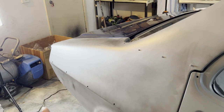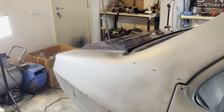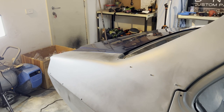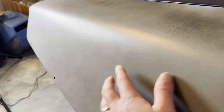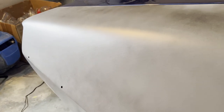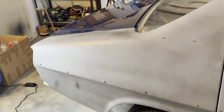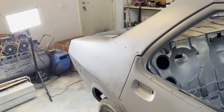This is one of the reasons why I try and emphasize on my videos that when you're doing repairs in your filler, you always finish in like 180 or 240. What that does is prevent all these scratches from happening when you prime it. Because if you were to sand that down and paint it, your metallic — when the paint's releasing all the solvents and drying, when the clear coat dries and everything sucks in — all these scratches here would show in your color. That's what's going to happen if you were to just sand and paint that. So when someone wants a nice job, you can't just sand and paint it. Always important guys — look at that, pretty vicious.